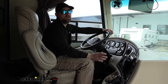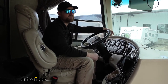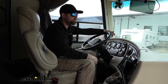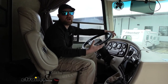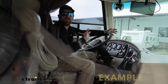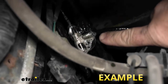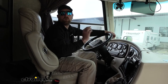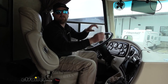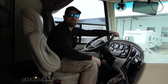Once you have everything hooked up, it's not a bad idea to start up the motorhome and let it build full air pressure. Then turn it off — we do this so we can check for any air leaks. Generally speaking, if you have one, it should be pretty loud and you should be able to hear it and identify it. You can go a step further and get some soapy water and spray down all the fittings we worked with. If you see any bubbles continuing to develop, you have an air leak. I checked ours — we're in really good shape, no leaks. If you were to have a leak, let all the air out of the system, disconnect the line from the fitting that's leaking, recut it, plug it back in, and go through that process again until you're confident there are no air leaks.